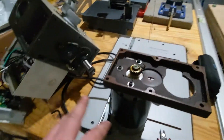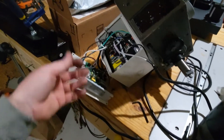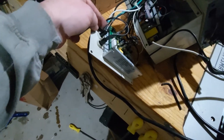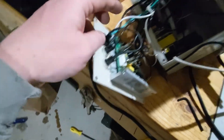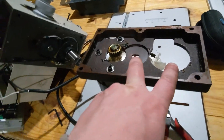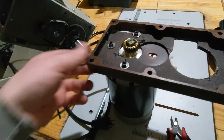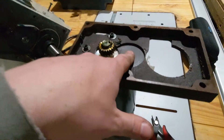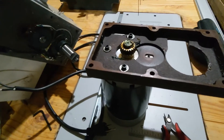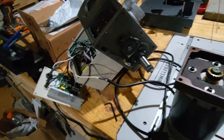Now that it's off the table, I cut the motor lines because honestly it's easier just to splice them than to try to weed through this rat's nest. The grounding cable is connected directly to the fuse, so unfortunately that's hardwired and soldered. But back to the screw — with the shop light you can now see how that recess accommodates the gear. The idea is to get it as low as possible using that screw and then use socket head cap screws for the rest. Everything's off the table and will get removed.